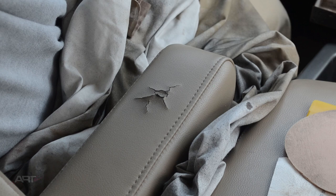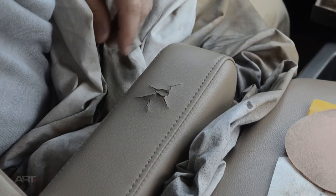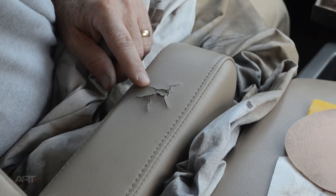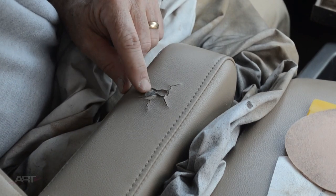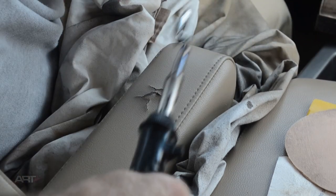Using an iron directly can supply the kind of heat we need. Someone made absolutely no effort to tame this brittle vinyl and left the edges showing. Since the repair was done, the vinyl has even rebounded and raised above the level surface. The buyer couldn't believe the dealership would have this kind of work done. In our damage, you can see that this vinyl has lost all of its plasticizer, hence all of its elasticity — it wants to live in this raised-up condition.